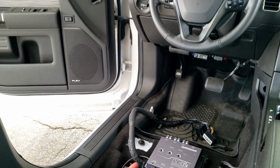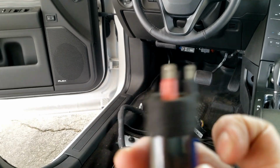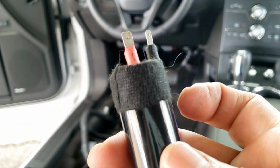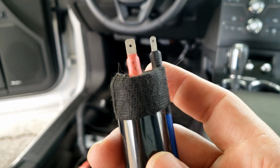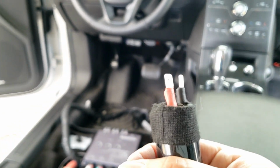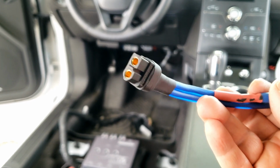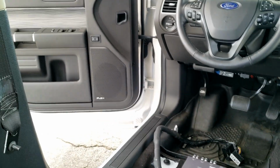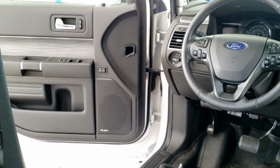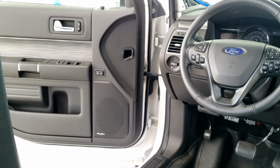This way I don't have to worry about these little plugs here possibly disconnecting from within the door. That would really suck if they disconnect and then cause a short. So I'd rather have the wire soldered on directly to the speaker, the opposite end have this quick disconnect, and then have a quick disconnect on this end to the end of the door over there on the panel. So that's going to be a little bit more work, but at least this will be easier for me to do on a weekend over having to spend all week long trying to put all of this together.